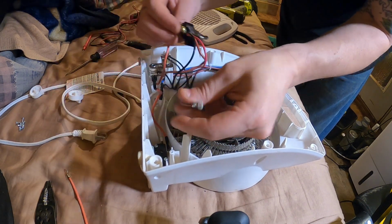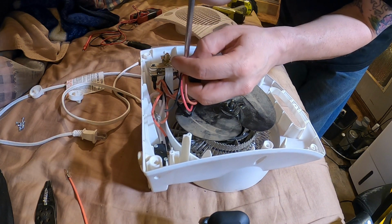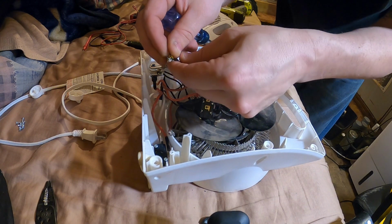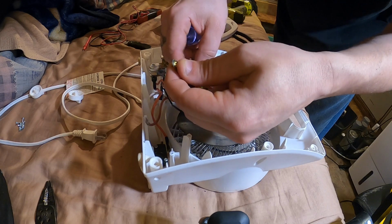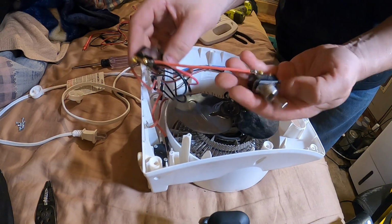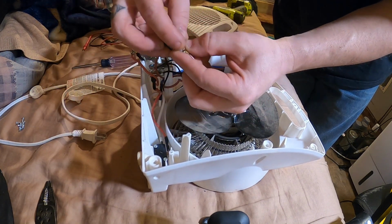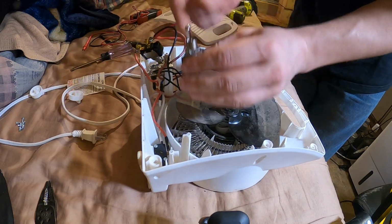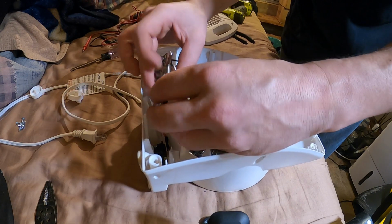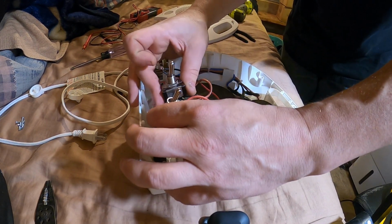Okay, heating element number 2. Oh, I forgot to put the jumper on there, because power also needs to go to switch number 2. Okay, power over to switch 2. Connects to element number 2. Okay. Heater element 1, one element, the fan and the indicator light, and power to switch to element 2 for high heat.